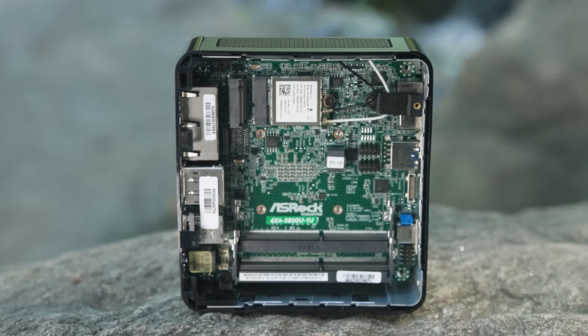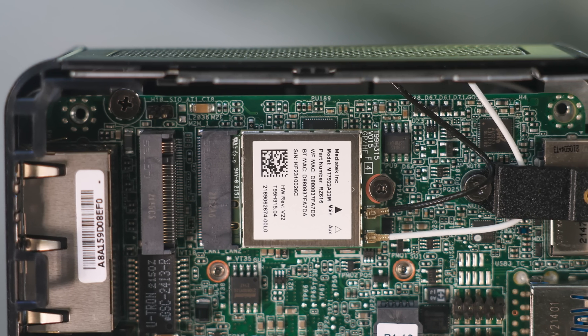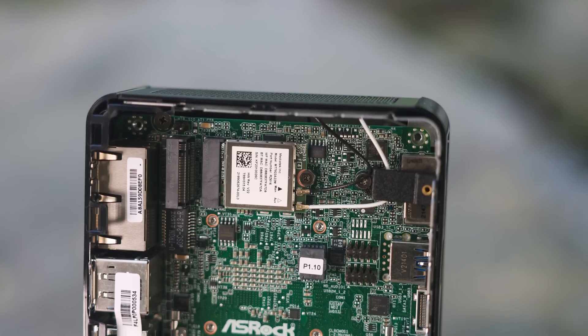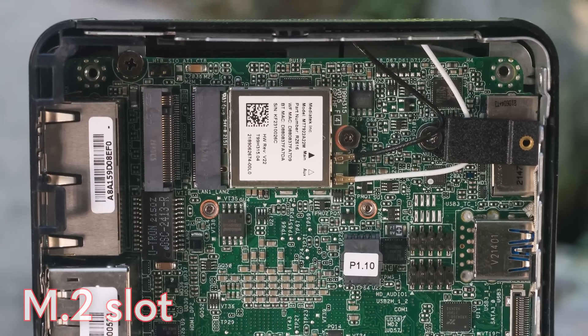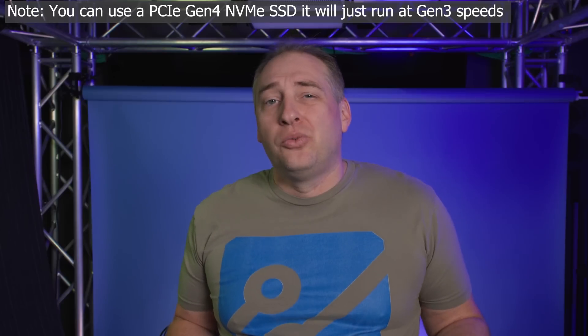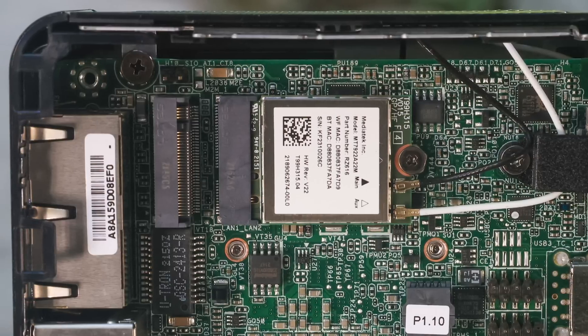Looking inside the system, on the top you'll see the AMD RZ616 — this is a Wi-Fi 6E module, so not just Wi-Fi 6 but Wi-Fi 6E, and it also has Bluetooth. I generally prefer the Intel AX series for Wi-Fi 6E, but this is AMD's solution, which I think is a MediaTek rebrand. Above that Wi-Fi slot, you get a slot for an M.2 SSD. This is a PCIe Gen 3x4 slot, so you can't use a PCIe Gen 4 SSD, which is probably fine since you don't want something that runs hot in a chassis like this. This slot also supports SATA, which is a lower-power option.